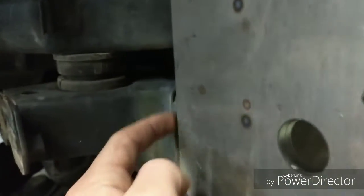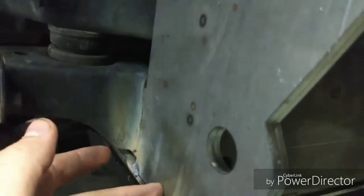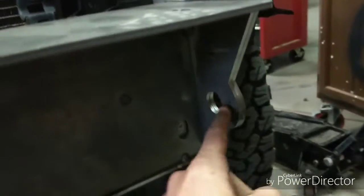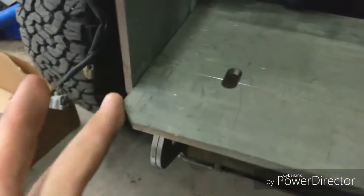Make sure you completely grind all the excess metal off the frame rails, because I didn't and now the bottom frame rail plate is bent and the top one inside is bent too. That made installing this piece difficult because I had to cut down here to get it to fit. Use magnets, make sure they're 90 degrees — all that good stuff — then tack them. The winch mounting plate, number six, goes on the front with the beveled edges.